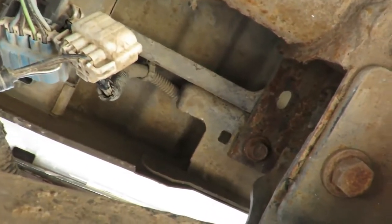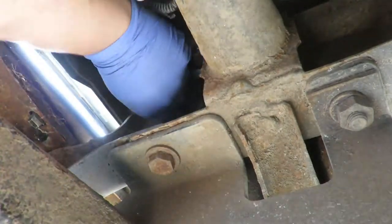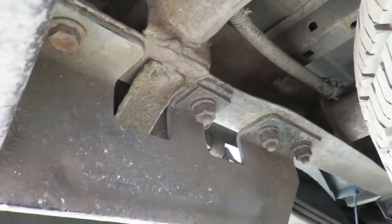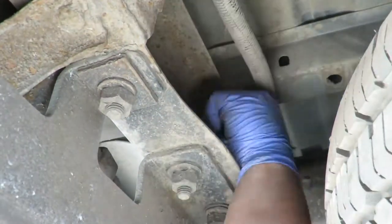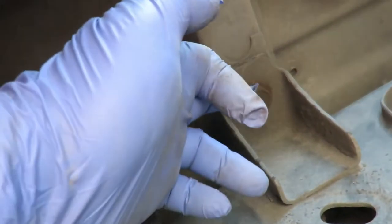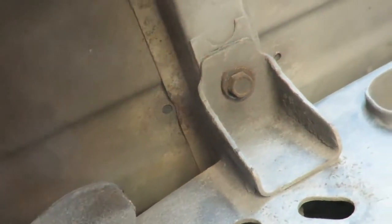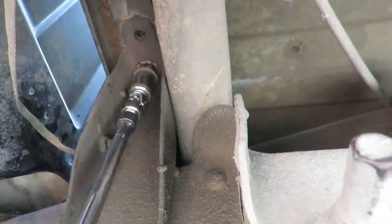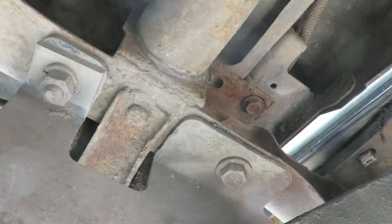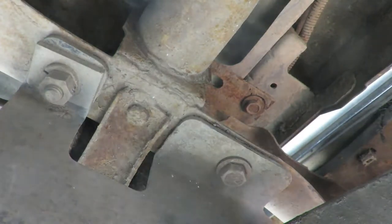The first one we're going to start with is the one closest to the wiring connections — it's an 18 millimeter bolt. We follow the frame around inside. The next bolt: here's your wheel well, and if you look on the inside frame, this is your next bolt. The last one on this side would be right there, right next to the front of the bed. Now we're on the passenger rear side and it's pretty much mirroring the left side, with an exhaust in the way or something like that.